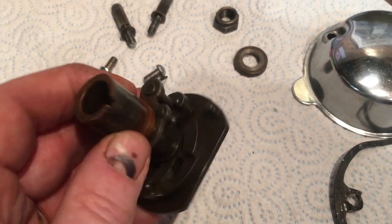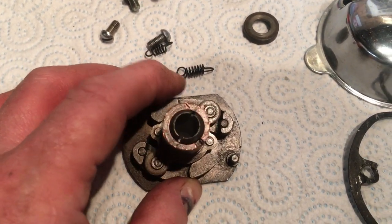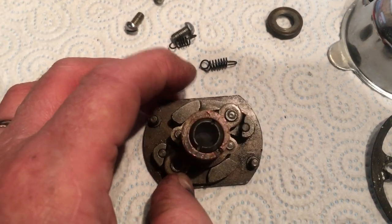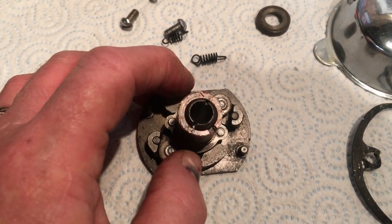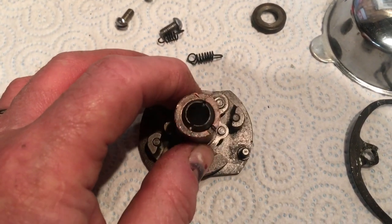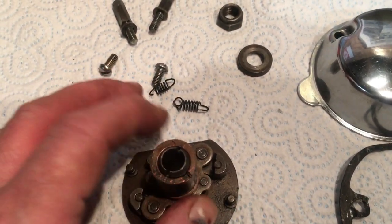the cam, I didn't mark it up before we took it off, so I'm not even sure if that's in the correct position or it's 180 degrees out. So it could all get very interesting, really. We're going to have to do quite a lot of checking with respect to position of the crank, firing cylinder, which points are which, and whether the cam's on the right way around as well. So it'll all get a bit intricate, but we'll sort it out anyway.